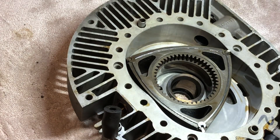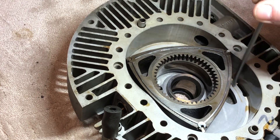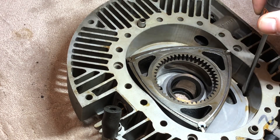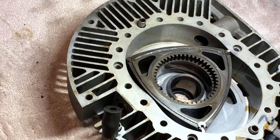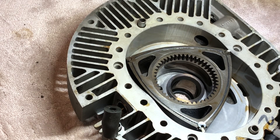We can see that it's a bridge port. These are the inlet ports; this is the bridge across the inlet ports to support the seal. This is the secondary port, and that's the exhaust port there. The seals and rotors look in pretty good condition — I'm just going to mic those up and see what the tolerances are. But it looks pretty good; I might do a little bit of porting on the case.